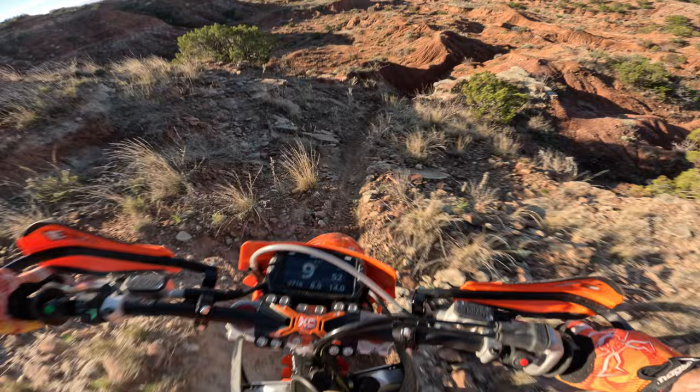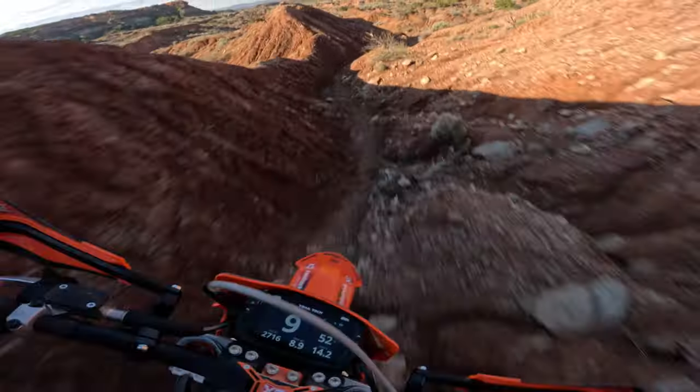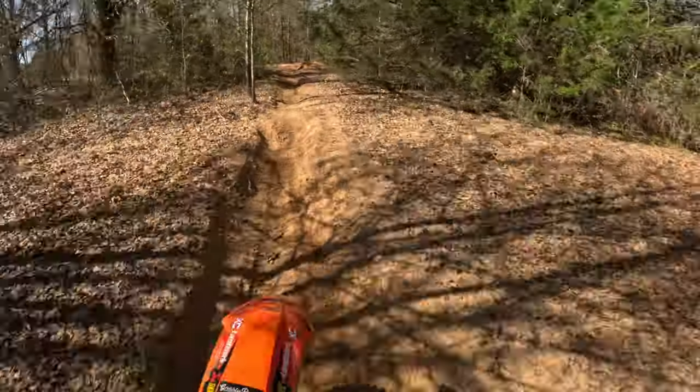For me, I would go with very small adjustments just so that I could feel something. Especially if you're going leaner or advancing the timing, doing anything that the module indicates in red, go with very, very small increments first so you can feel the change. Also, the leaner you go, the hotter the bike is going to run and the more your chances of engine failure are going to increase. So with the ERM, I just did the straight TSP tune first, and it was a noticeable improvement over the stock ECU tune.